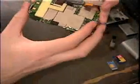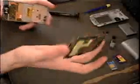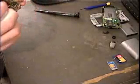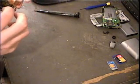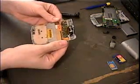Yeah. Okay. Lift it up, pull the cable out. Set this board off to the side. You don't need it for right now. And now you can just push out the screen.